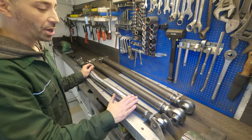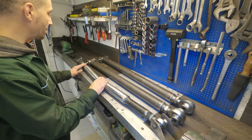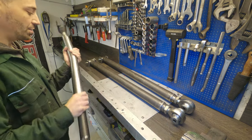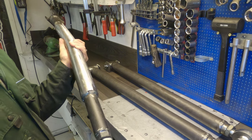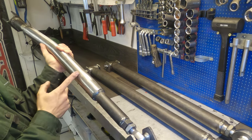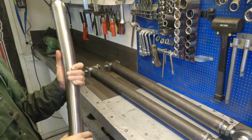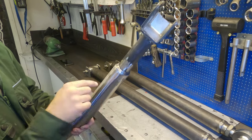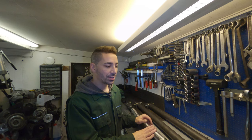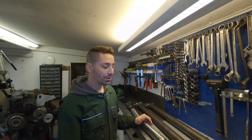We've got some big old control arms — I'm going to call them dong arms. Two lowers, one upper. The upper's got a slight bend in it, although I probably need to adjust the end. I built this using the short arms from Rough Stuff — the seven-eighths tube at one end, a piece slid up and plug welded everywhere, same with the other piece, then welded around the top. The next step is getting them bolted in and tack welded in place.